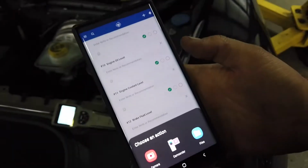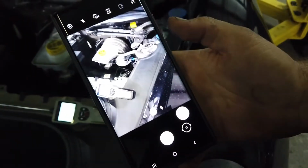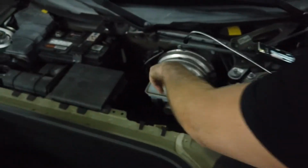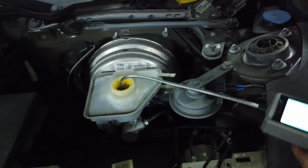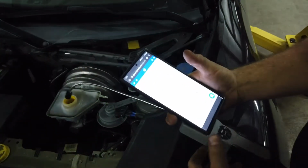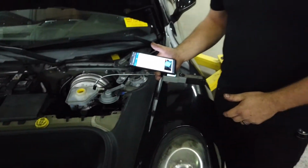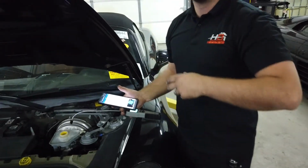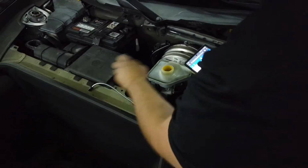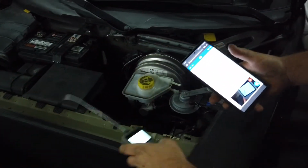Right here we have the brake fluid, and what we like to do is grab a picture of it from our nice little percentage calculator here. Just stick it on, and then there it tells you the percentage of moisture inside the brake fluid content. Is there a certain percentage that you want to be looking out for? Anything over 2% is usually something that becomes worrisome, because it can cause brake fade and whatnot. The brake fluid gets up and it starts causing issues. So you take that picture, put it in the MPI there, and we're done with that.